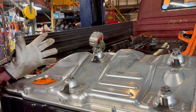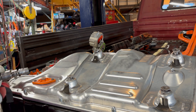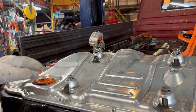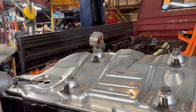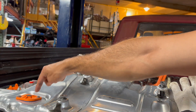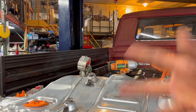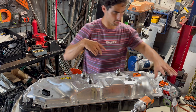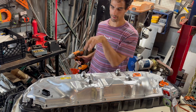I'm in the shop alone. I am recording this — if I die by touching things I shouldn't touch, delete this video for life insurance reasons. But actually, this is very safe. There's an access port that you can open up and check to see if the contactors inside the battery pack are still open. Success — no voltage between any of the plugs in there, nothing. So either this battery is dead, or hopefully the contactors are just not engaged, which is how it should be. Now we're going to disconnect everything and just peek inside the battery.